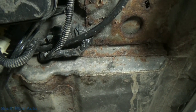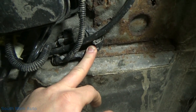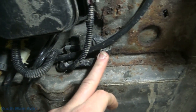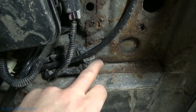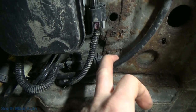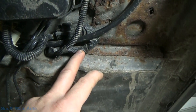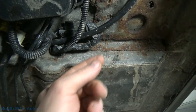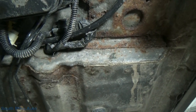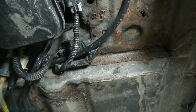And you can see somebody's already been here, or at least I assume so, because this has big wads of what appears to be duct tape or Gorilla tape of some sort. I doubt that's factory. The service bulletin says, you know, repair the harness and then lightly zip tie it to the brake cable. So we may have an issue in there.